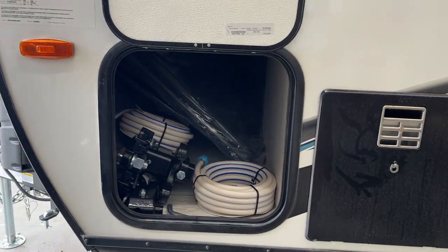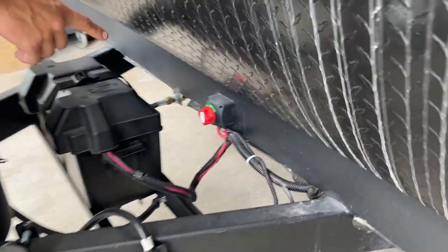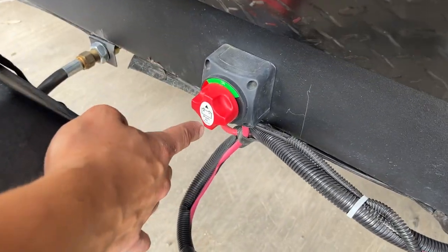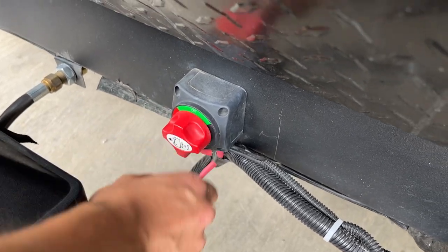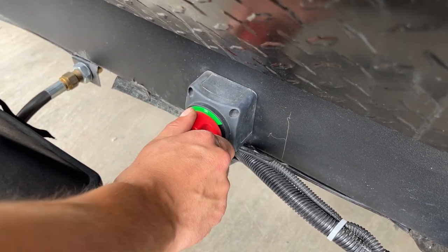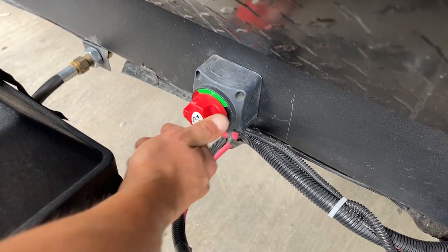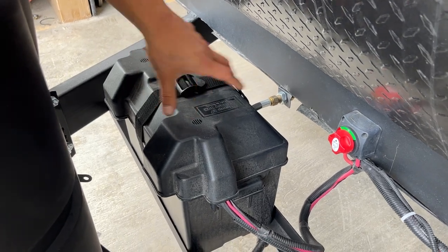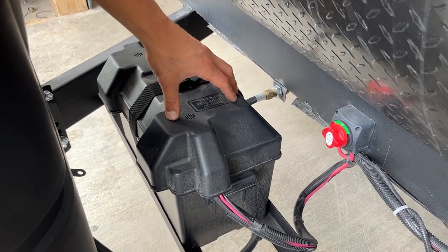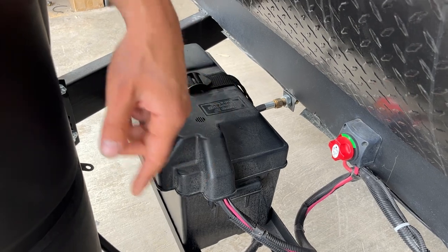This storage compartment also sees straight through to the other side. Right around the front of the unit, there's a little black box up on the frame — that's your battery disconnect switch. With it pointed up, it's turned on. Turned to the side, it's turned off. The unit is prepped with solar and all hooked up, so you can just leave that right on — the solar panel will keep that battery charged. The battery itself is inside this box here, and as long as you're plugged into that short cord in the back or your seven-pin tow vehicle, that battery is charging.